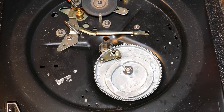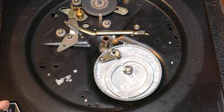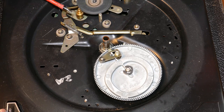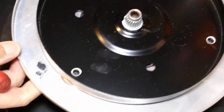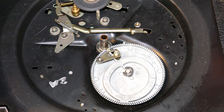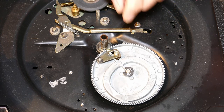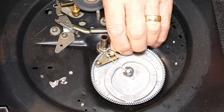With the platter out of the way we can see all of the upper deck mechanics. At the top of the screen we have the stepped motor shaft and the idler wheel. Selecting the speed of the record raises and lowers the idler wheel so it engages with the part of the drive shaft that corresponds to the speed of the record. Now we've revealed the large gear wheel with the cam and the trip pull. The gear wheel engages with the gear around the shaft of the platter, so as the platter rotates it rotates that large gear wheel. This should all be fairly freely moving, but we can see the trip pull is very stiff.